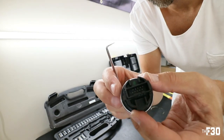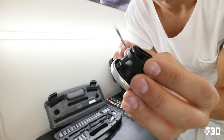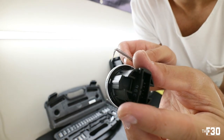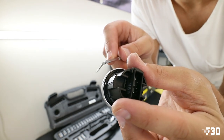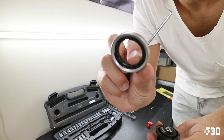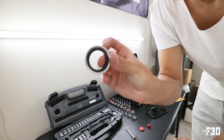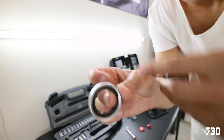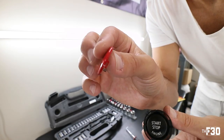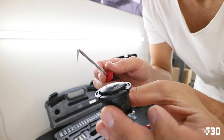We get the clips out and then this whole assembly comes out. For this next part, we're going to use a little pick tool. You can see these little silver notches right here — behind those are little pins. So you're going to want to get in there; it's going to be really hard to show you, but I'll show you once it's out. You can see that little silver in there — that's the pins. You're just digging in and unclipping it, and you go around the entire piece until you have all of them unclipped. Then that ring and the inner ring come out in one piece. Then you have your start stop button. For the ring and inner piece we just pulled out, we're going to be repainting all of this — I'm going to sand it all down and repaint it black.